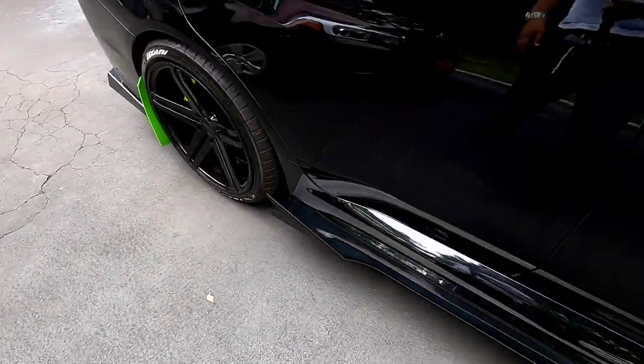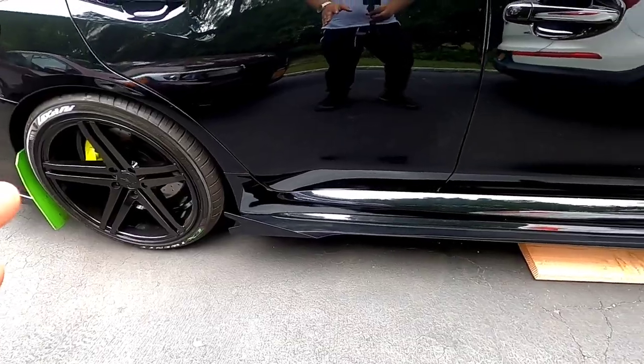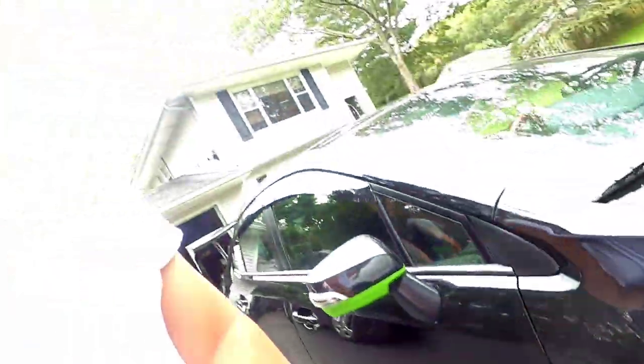This is definitely going to be a keeper. If you do have side skirts, when you take your old side skirts off definitely clean the under panel with some type of brake cleaner — I use Amsoil brake cleaner. Clean it off so the 3M tape will adhere to the underneath of the car. Even if you don't have side skirts, make sure you clean off the surface. That's really it — let me put this other one on real quick.